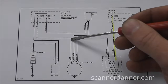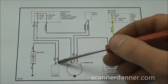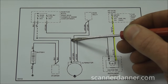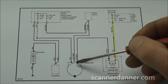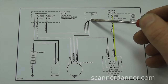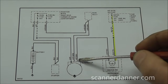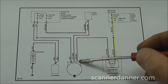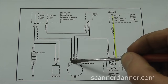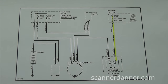You can see the alternator is grounded on the housing. We have a solid white wire going to a main fuse and then coming directly to the battery — that's your heavy cable going to the starter, hot all the time. Then we have another wire, white with a green, coming from the main relay — that one's hot in run. And then we have another one that's the bulb circuit for this alternator. We'll start with the heavy gauge white wire with the car running and move down the line.